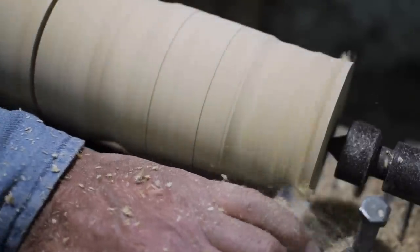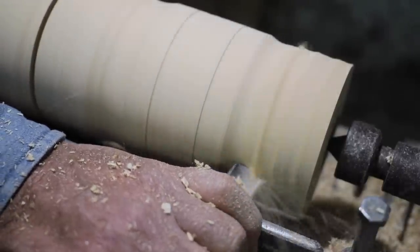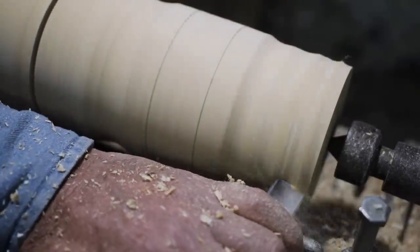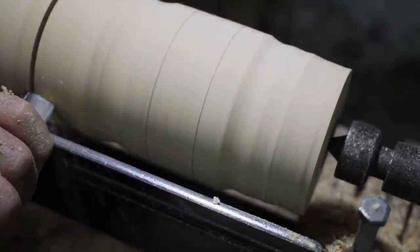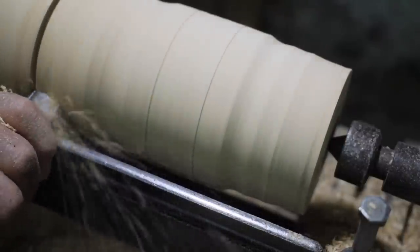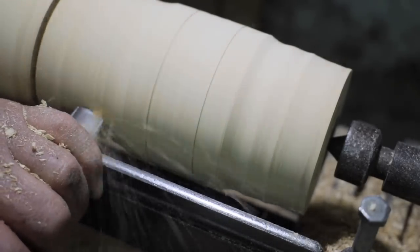In a Sarven hub core, there's 4 places you want contact, and they're equivalent to the four bands on a wood common hub for a wagon. These are the two places of contact right up against the spoke, and then on each end of the hub core where it comes in contact with the hub flange. In between those four places, I'm going to work it away to where there actually is not contact.